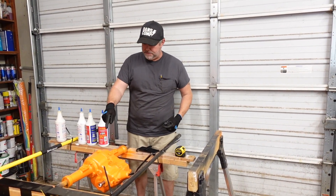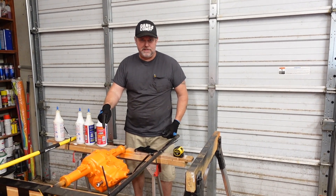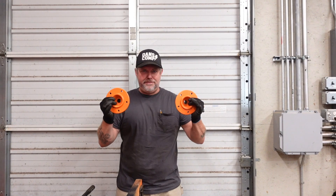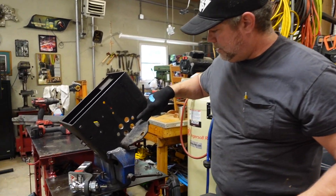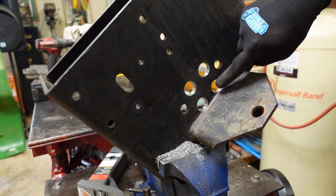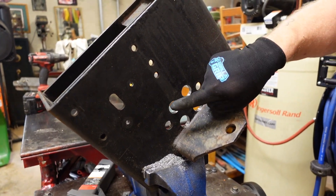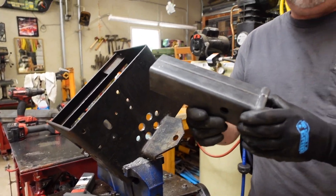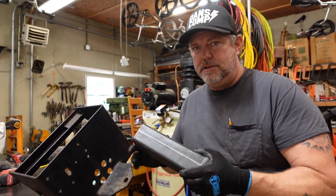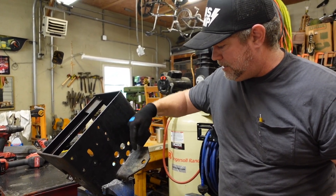It's been about a day and a half since we did the locker. Since then I put it back together and gave it a fresh paint job — and we gave the hubs a fresh paint job too. I got a little carried away and started working before I filmed anything, but I wanted to cut you guys in. I cut four holes with a hole saw because this is going to sit on top of this stock plate. I'm going to cut these holes together so I can insert this two-inch receiver tube through the frame, just about a quarter inch past it, so I can weld it around inside, outside, and along this factory hitch.